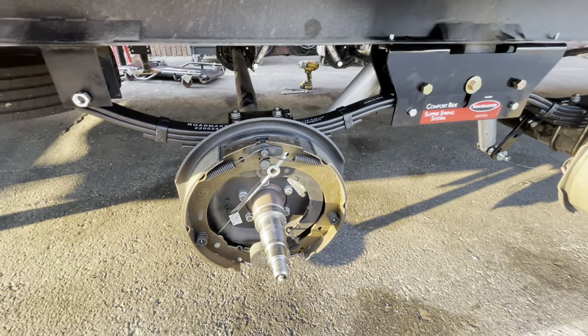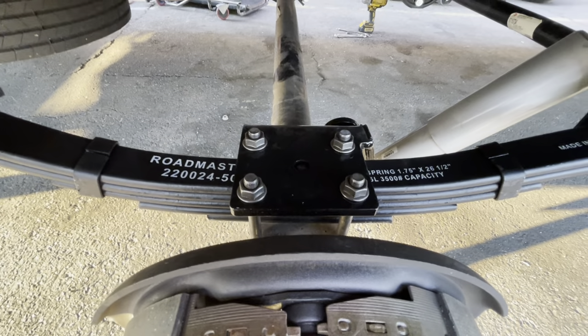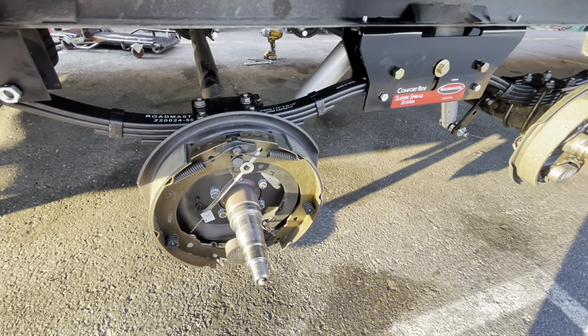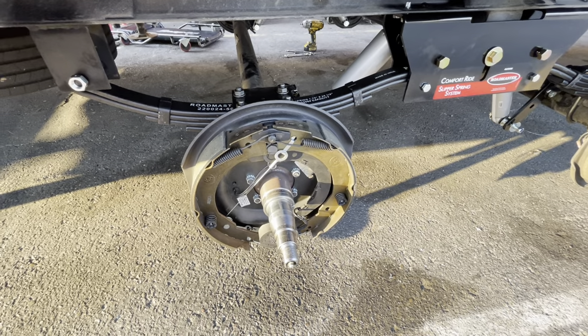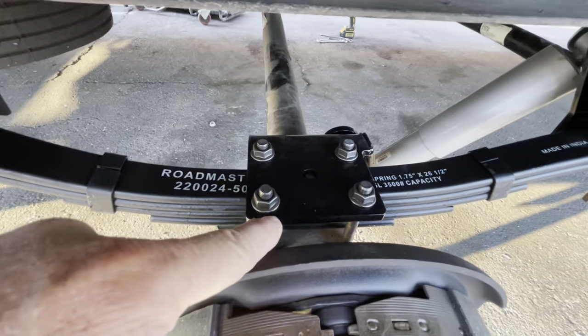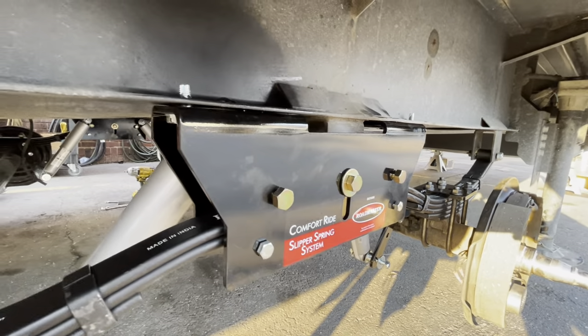On the plate for the U-bolts, it's always all new U-bolts when we replace this. When you're coming in for your yearly maintenance to do a wheel bearing pack, make sure you have your shop go back and check the torque on the U-bolts, and check the torque on the bolts on the pumpkin or apparatus.